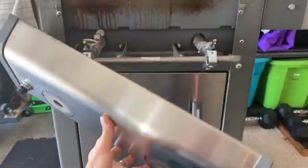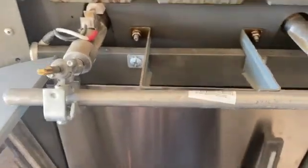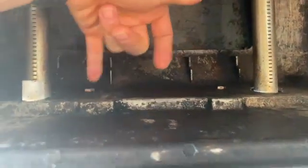And attaching onto here is going to go the new hose and regulator, the one you can get on Amazon. All right. Okay, now that we've gotten this panel off, you can carefully let it hang there. And then, like I mentioned, these bolts here, this side and this side, are going to have to come off. This nut and this nut, and directly on the inside. Hold those with either an 11mm socket or your crescent wrench.